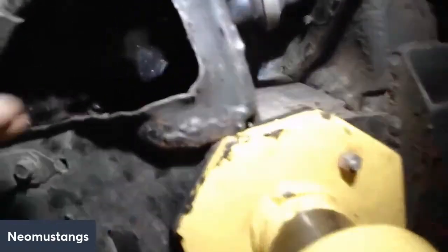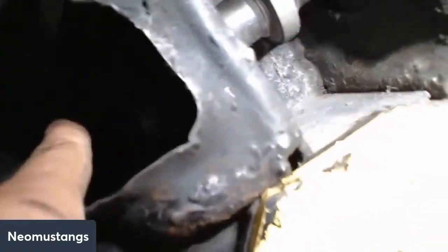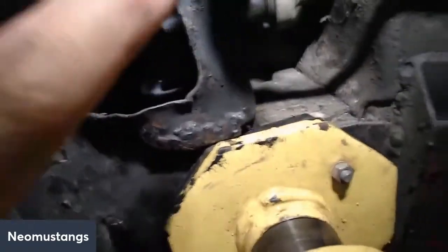You want to look inside for rusty areas. You want to look for rips, this whole box being ripped or crunched. Torque boxes are something of major concern, because if you screw a torque box up, it's kind of difficult to get it replaced. Torque boxes get ripped. As I mentioned in the video, they need to be welded and reinforced. You've got to look inside of them, man. That's where the rust is at. You might look at it and say, oh, the torque boxes are good, but it's all hidden up into the rails. Definitely an area of concern.